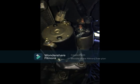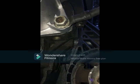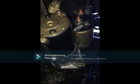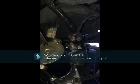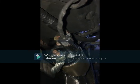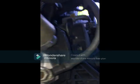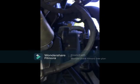Okay, so this is how your starter should look like when it's all in. You have your ground wire in the main body. I use the old nuts since the new one didn't come with any new nuts. And then you have your solenoid positive, your engine main positive up there, and the ground, okay? So it should be inside like that, nice and tight. So I'm gonna put the panel back. Let's get out here a bit.